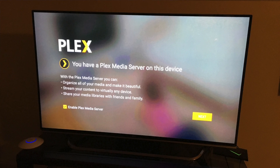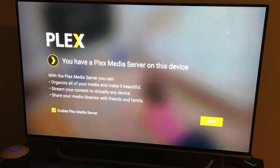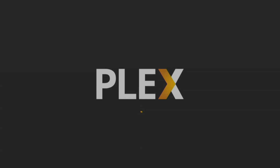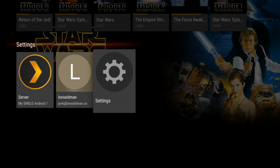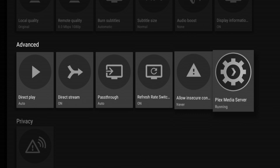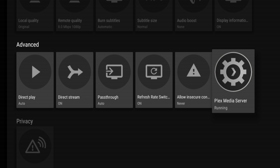So let's see how all of this gets set up, because there is some really cool stuff they added to make it more convenient. When you first boot it up and go into Plex, it's going to ask you whether or not you want to run the server. If you select yes and later change your mind, you can go into the Plex settings on the Shield device, and go over to a spot where you can disable it — it's down here at the bottom under Advanced, and you go over to Plex Media Server where you can then shut that server off if you don't want it running in the background.